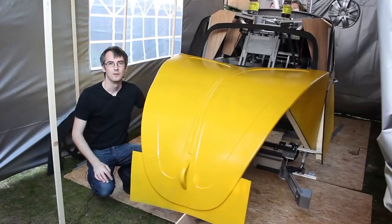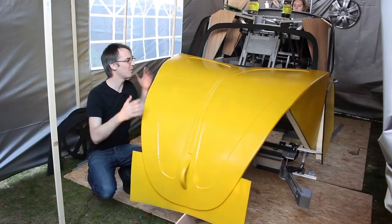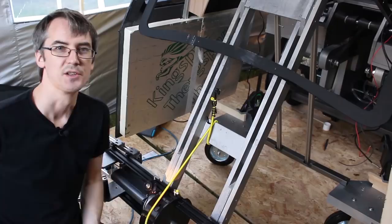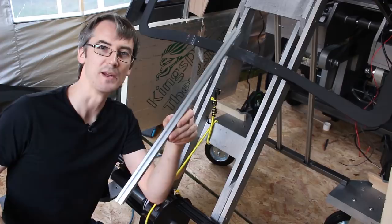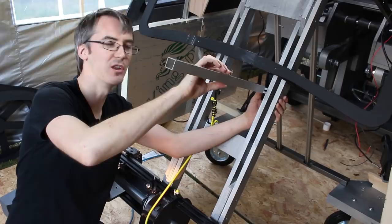We're getting there with the body panels. The only piece of the car that's not part of the transformation is the bonnet, which has to be ejected and thrown away, because it's absolutely huge and there's nowhere to put it. In the movie it looks like it folds up into about eight pieces and magically disappears into Bumblebee's chest, but that's going to be a bit tricky to do. So we're going to make a bonnet ejector — some sliding rails out of 20-20 extrusion and box section, mounted on the front forks angled up slightly, so the bonnet sits down on them, and then some sort of pneumatic air cannon that pushes the bonnet off and ejects it. There'll be more on that next time.